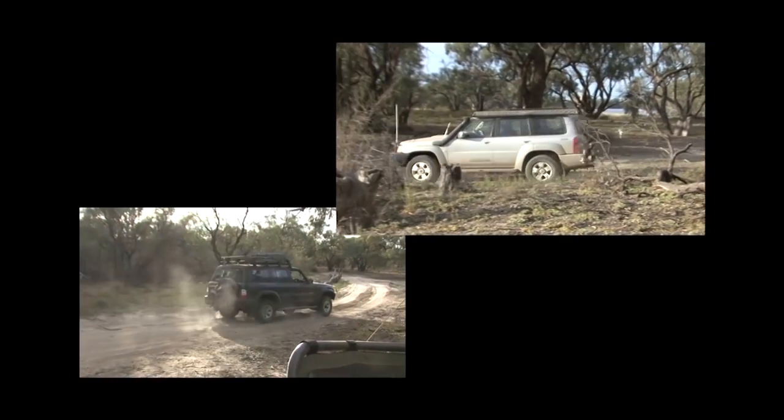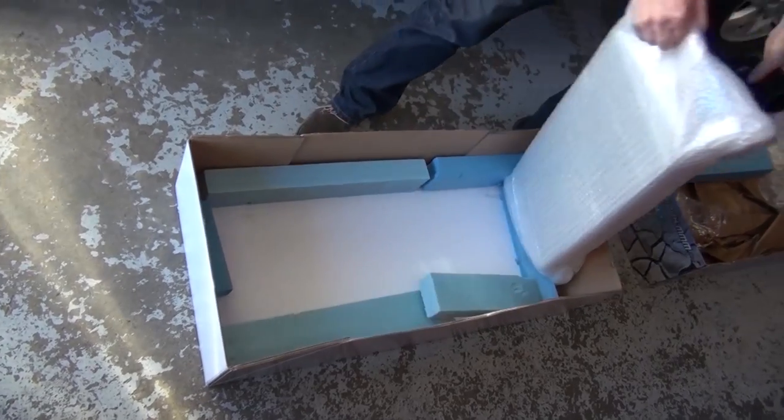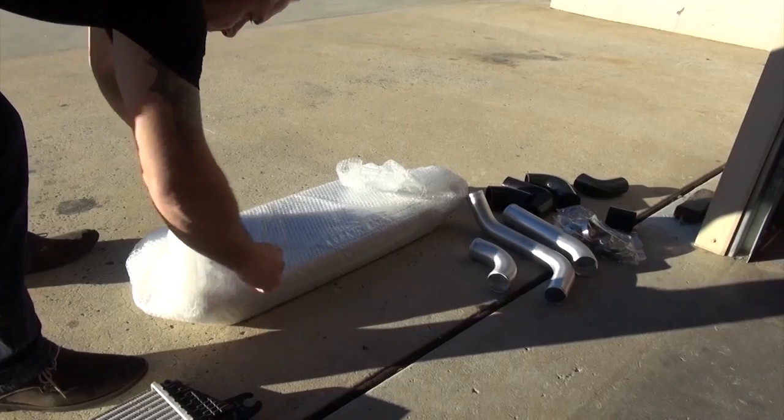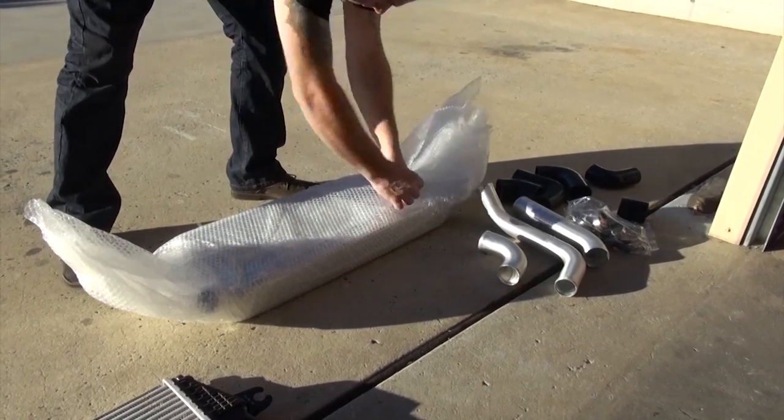The other upgrade that is a good idea with this vehicle is to upgrade the intercooler. These do run hot internal temperatures, or pyrometer temperatures. So putting a decent quality upgraded cooler like either a HPD or a cross-country cooler will actually help the longevity of the engine. The cooler you can get those temperatures, the better it'll run, the more reliable it will be.